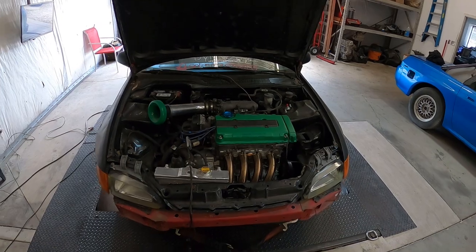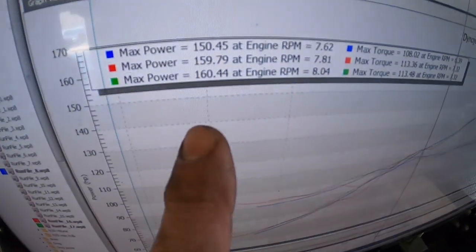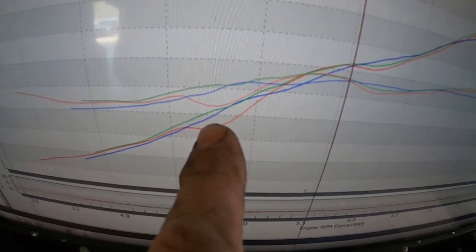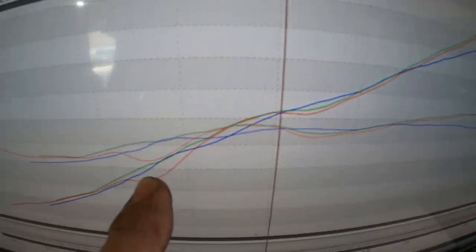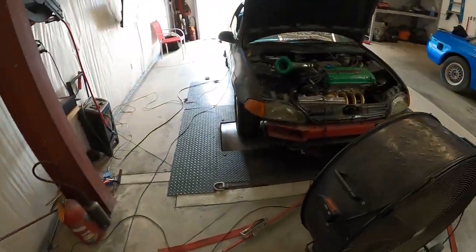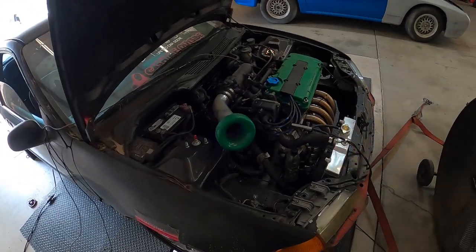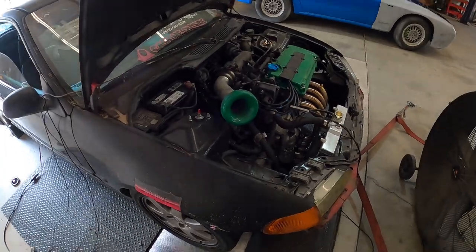I think that's all she wrote for this. Our last pull: 160 horsepower, 113 torque. VTEC cleaned up from the run before — the last run was the green run. Air fuels are good. Can't find any more power in it. 160 is our final number — up 10 horsepower from two years ago. See you next time.